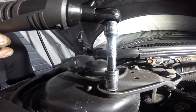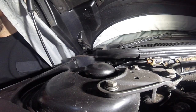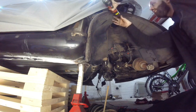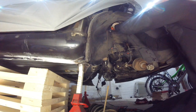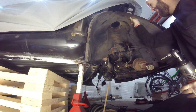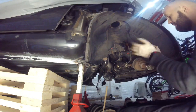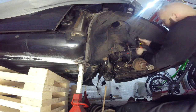The top mount nuts - 13mm again. Obviously you don't take the last one all the way out until you've got hold of the shock absorber - goes without saying. Last but not least, the screws to remove the under-arches. Again I was really pleased to discover that there's next to no rust - very little, none really, certainly nothing to worry about.